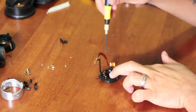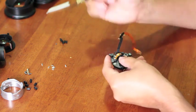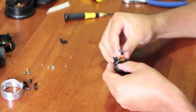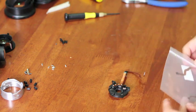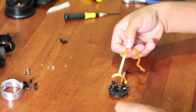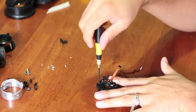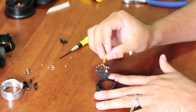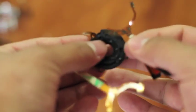You can choose to stop here or go a step further by separating the flex cable from the aperture piece. You will have to desolder the eight contact points on that flex cable and put a new one back on. This is the part where I had to stop because I did not correctly desolder it and messed this part up, but you can purchase this final piece on eBay so that you don't have to solder. If you're fine soldering, you can remove that flex cable from the aperture ring and re-solder the new one together.